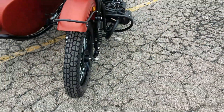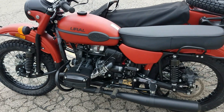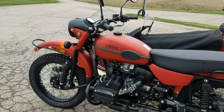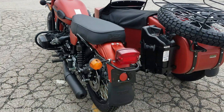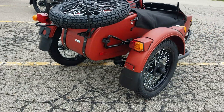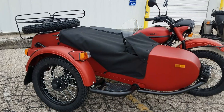Very simple, easy to do at home in your garage or on the road. You can see the silver alternator mounted up there — 55 amps, 770 watts — plenty of juice, enough to run two sets of electric clothing and keep up with the lights and everything. New units come with a two-year unlimited mileage warranty that covers parts and labor on everything other than consumables.